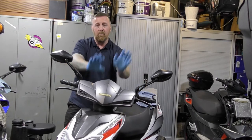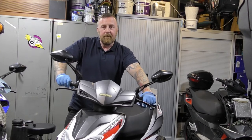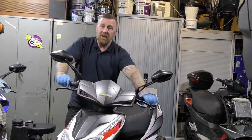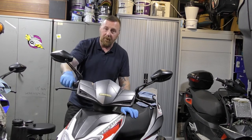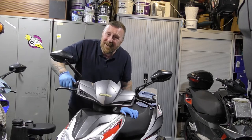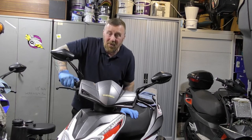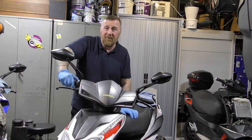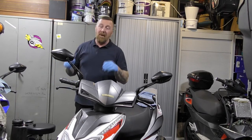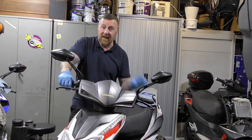When it comes to four-stroke, like this little moped here, scooter, motorbike — it doesn't really matter as long as it's a quality 10W40. Remember your clutch is separate from the engine, so it's just like a little car engine. It doesn't really matter the grade, if I'm honest with you. If you want to put semi or fully synthetic in them, that's fine, but just a good quality 10W40 multi-grade is fine for the 50cc up to the 125 moped scooters — the ones that don't have a clutch in with it.